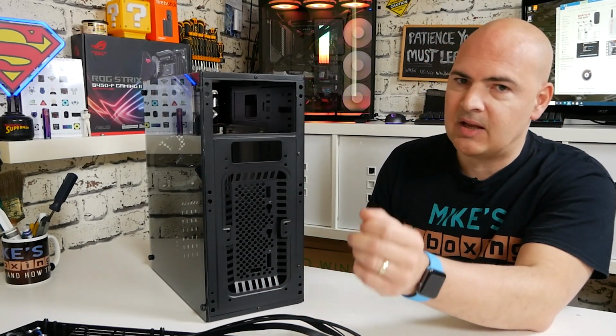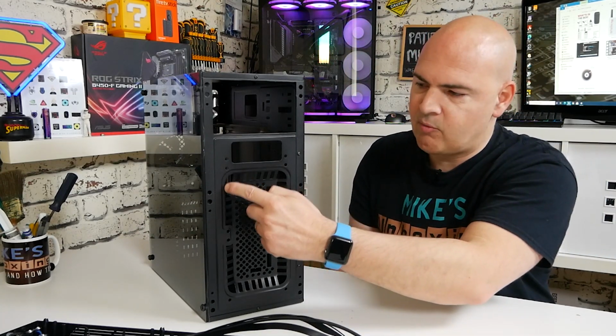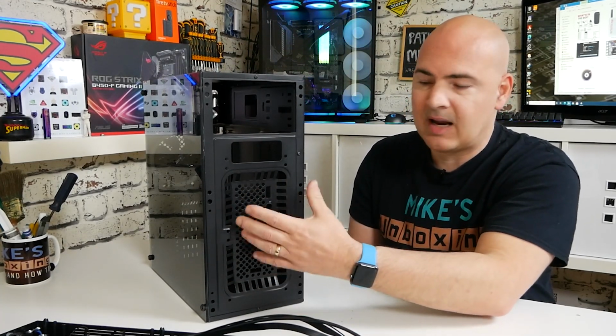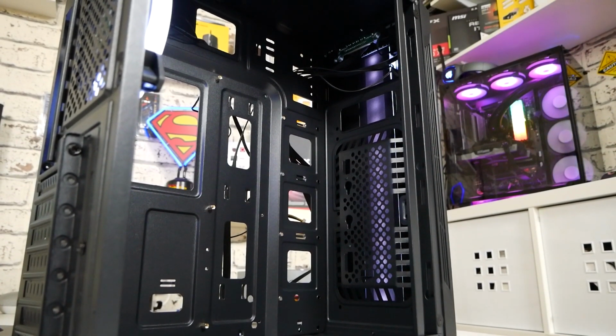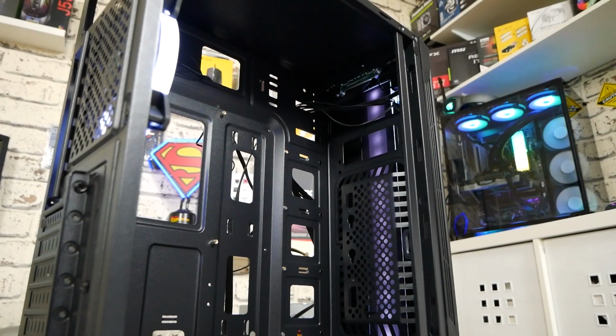My consideration, in this particular instance, would be to use an angle grinder or cutting tool and actually remove those arms around the outside edge and remove this panel altogether, then allowing you to put two fans on the inside. Currently you can't put them on the inside because this drive mounting area actually is recessed, so you can't physically mount fans on there without hitting the metal.